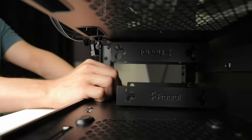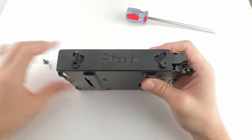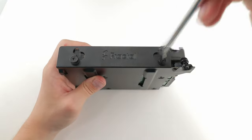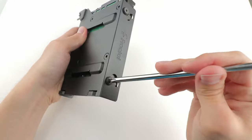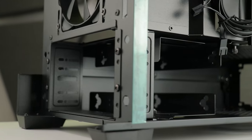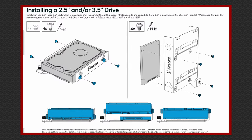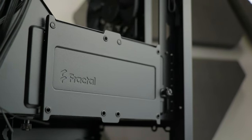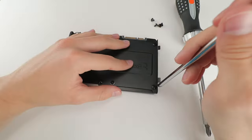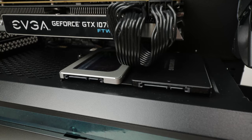The drive installation was very simple. I think it's really interesting how we keep seeing lots of different ways to mount 3.5" drives in cases, but they correspond to the 5.25" bays at the front, which is pretty good — some actual innovation in the PC case space. But wait, there's more: you can install the 3.5" drives in the higher side slots and install a 2.5" drive below it. The 2.5" drive install into the dedicated panel was just as simple, and you can install the bracket in either the back or the top of the basement shroud in the main compartment.